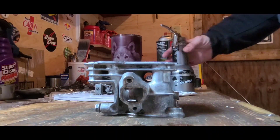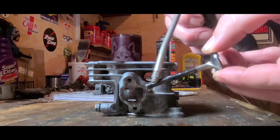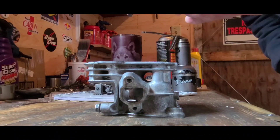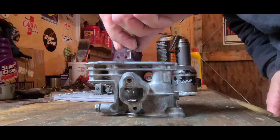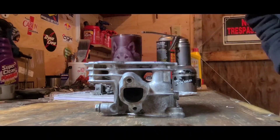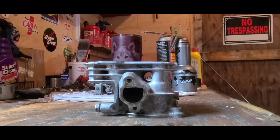I'll show you how I do one of these — oil on the stem. Now carefully place it into the guide and slide it down in, making sure that there's no grinding compound on the stem. Because if that gets down inside your guide and you start lapping, you're going to mess it up quick.